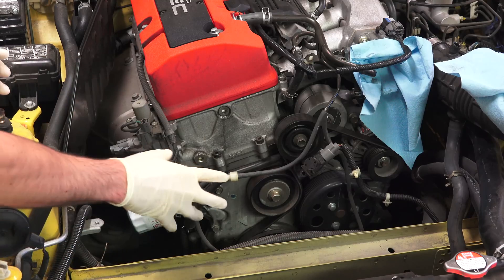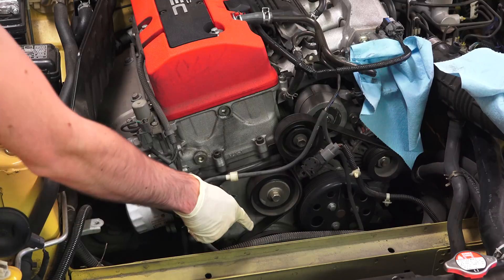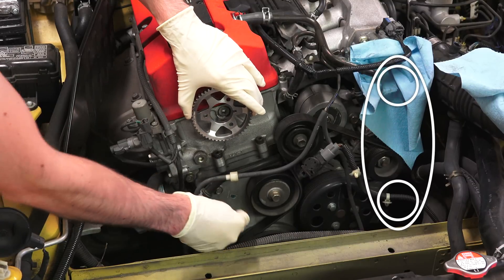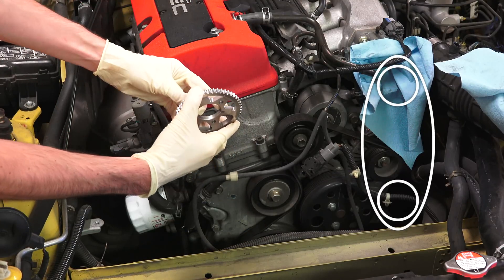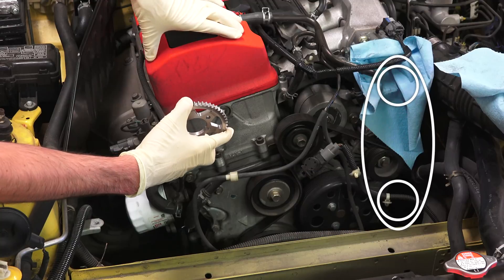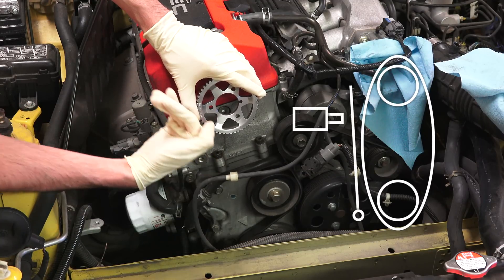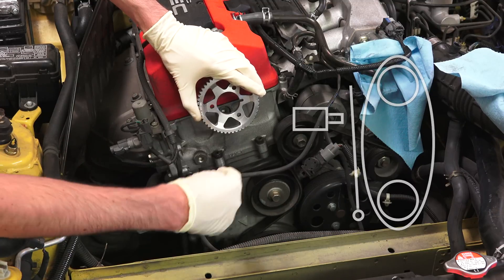First let's visualize what we've got going on with our engine. Here we have our engine block. Our crankshaft is going to be down here and there's a timing chain which matches up with this idler gear up at the top, so it goes from the crankshaft up and back down. This has connections to additional gears which drive both of your camshafts — your exhaust and your intake. The timing chain tensioner is pushing in on a tensioner arm right here, which is pressing up against that timing chain running up and down.